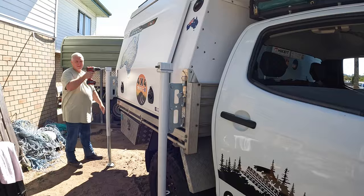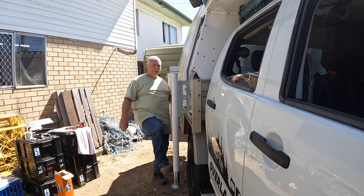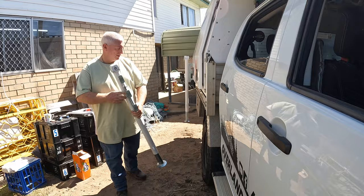After you've got the camper all lined up and lowered, the legs are easy to get off. You give them a kick with your boot. If you haven't got boots on, a rubber mallet does the trick — you will need something, you do have to give it a bit of a kick. I've done it in pluggers before, but as you get older and you start to respect your feet a little more, the pluggers are a lot less used. Once the legs are loose, there's a little safety clip on the top — you just pull that back and remove the legs, and the legs go away.